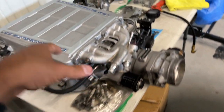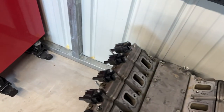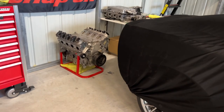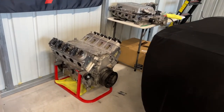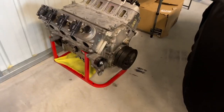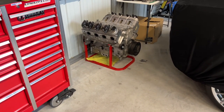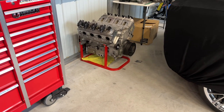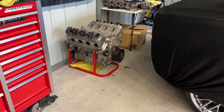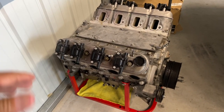We are going to keep this blower, but everything else is going to get reworked. It's going to go to Kong — we're going to get their new lid. We are going with a new block and it is going to be an iron block. I know for my ZR1 people that does suck, but the iron block is just going to give me the longevity and robustness in the long run. If I decide to hook up two nitrous bottles and spray a 300-shot, and if I hurt a piston or cylinder, all I have to do is bore it out because it's iron — no sleeves.